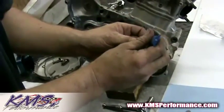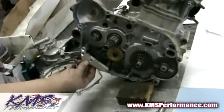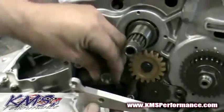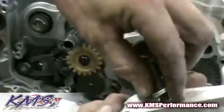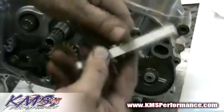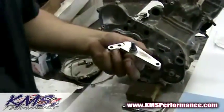A little bit of Loctite — don't forget your Loctite. Now, obviously this support is going to be sitting like this, so we want the pin to actually come in from the back side. Basically you're going to thread it this way into the aluminum piece, and then we're going to go over to a vise to put this in and make our final torque.